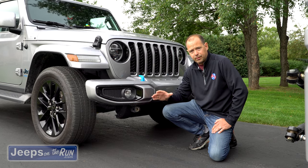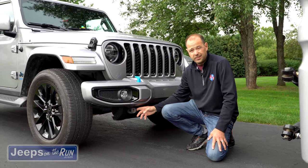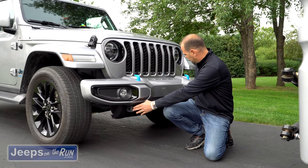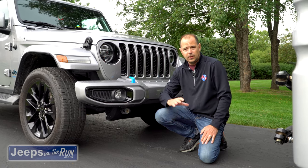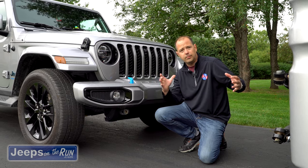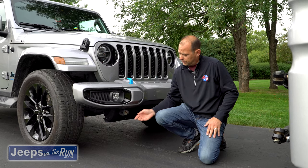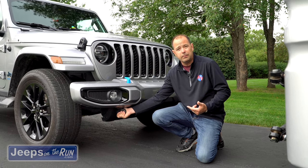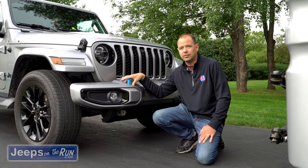As previously discussed, we've got plenty of videos on how to install these loops. The advantage is it's a nice, clean install and it tows great. The disadvantage we're just learning is that when you have the vehicle connected, there's actually no connection between the two loops. What they're seeing in the field is when the Jeep is on a hard brake, or the RV is on a hard braking and the Jeep comes into it, the Blue Ox wants to open up — and some of these are actually bending. This is usually an extreme case of very hard braking, or when you're not using a braking system in the Jeep.